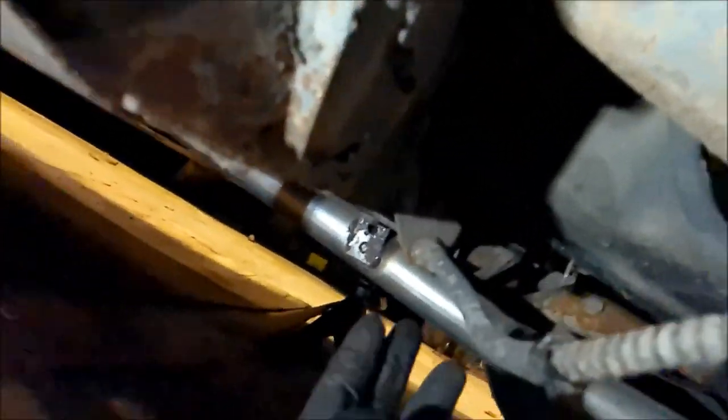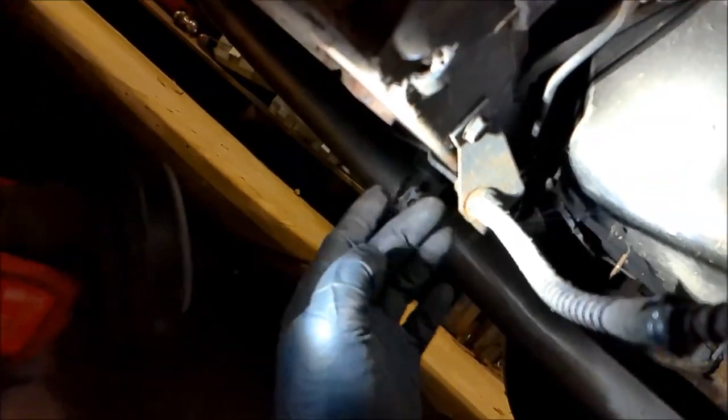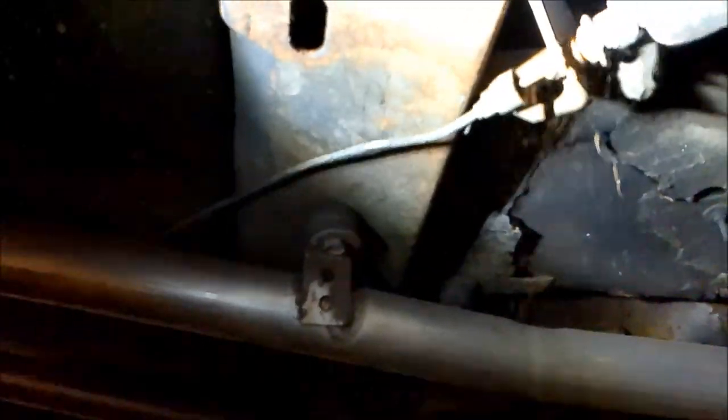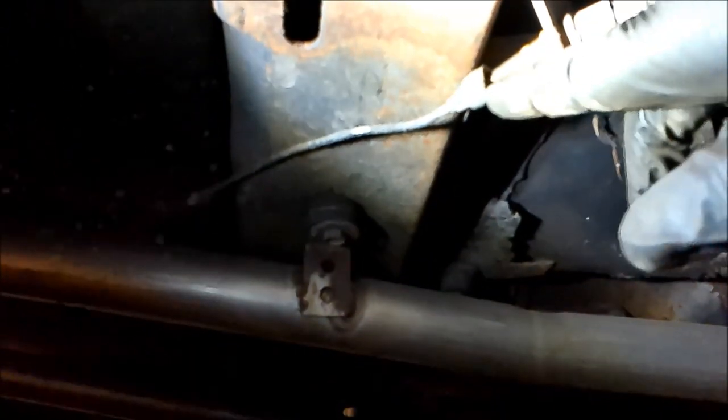All right, got another clamp. Where's my light at? Right there. And yeah, it's got that Mickey Mouse clamp on it right here on the back side. And apparently I'm going to have to do the same thing to disconnect it there. All right, let's do it. Okay, I've got the Mickey Mouse clamp out. I've moved this rubber boot back with the screwdriver some. Just pull forward, see how it drops down, and he's free.